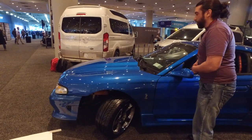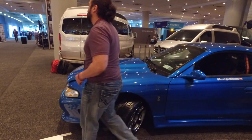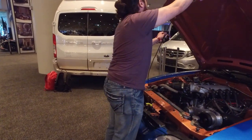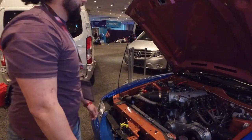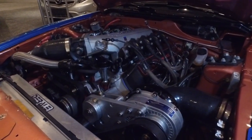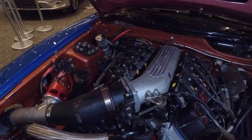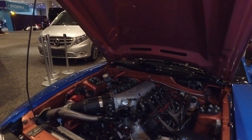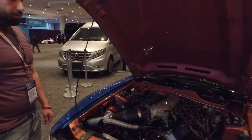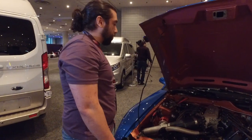Anything under the hood? This is what drives the back wheels — a B50 short block, Ford Motorsports 302 stroked to 331, Edelbrock Victor Junior heads, custom Lunati valve train. Everything top to bottom built. PCHS Racing built the long block. Just had to redo the cylinder heads recently — I broke valve spring keepers. Pro charger D1SC, electric water pump, Edelbrock Proflow XT intake manifold.